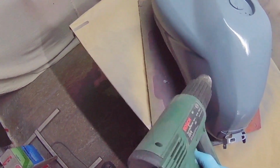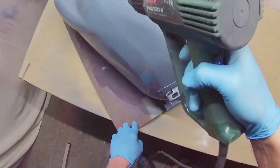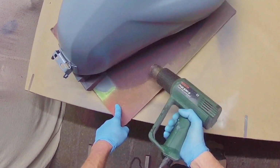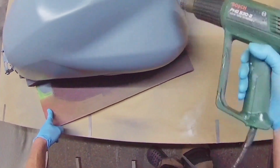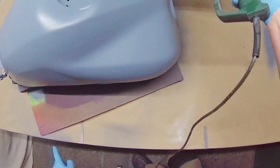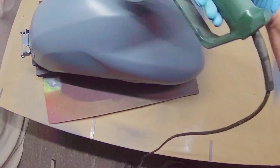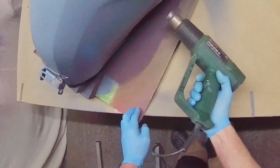So you really only need the tip and the needle if you're changing these different sizes, but you get the cap as well. So for 60 US dollars, including shipping and including tax in the UK, I got myself effectively 3 spray guns in one. A 1.3, which you can use for base coat and clear coat, a 1.5, which you can use for primer sealer, wet on wet primer, etc. And this in 2.0. I didn't want it in 1.7 because the primer I use is quite thick. It's quite a high build primer.